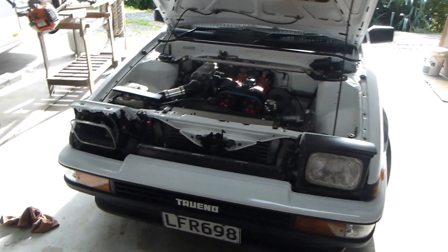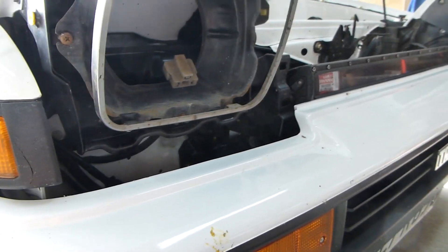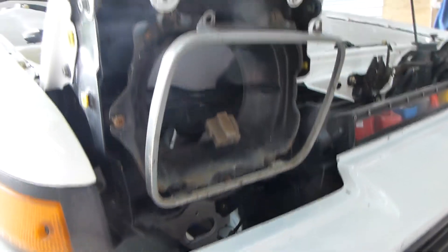Should be pretty good. I've got some already sort of semi-blue bulbs in there, so they should fit right into these. These are way more crystal clear and should change the whole front of the car quite nicely. It's just a matter of taking the surround off and taking this off. One of the bolts was pretty rusty, as always, so that can just stay there for now. Clean that up, put new light in, new surround on — be away laughing.